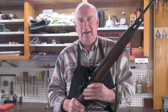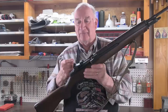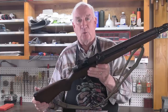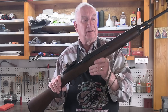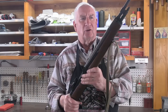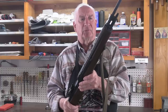Welcome back. With this M1A, I've taken you on a three-part odyssey of how to accurize it. I started first with glass bedding the rear sight so that it had no wobble anymore. Then we glass bedded the action, and that really tightened things up, and I showed you how very simple that was to do. It's not complicated, and you don't have to go through any heroic measures of gouging out lots of wood, and that really tightened up the groups.